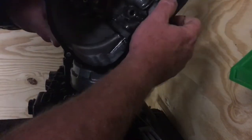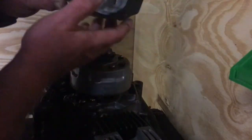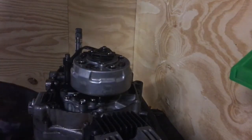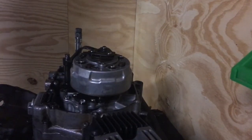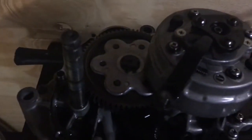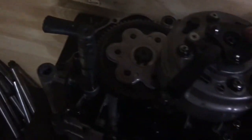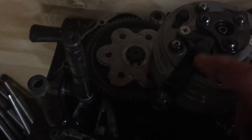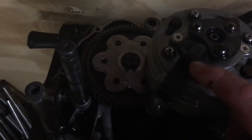You can see that sludge in there, all around the bottom there. I'm going to pick the camera up and just get you in so you can see this strainer. So you've got your clutch — this is a clutch adjustment here where it comes through, and there's a spring here. This all comes off. Don't be afraid of taking this off — I was the first time I did it, but it's actually not that bad.